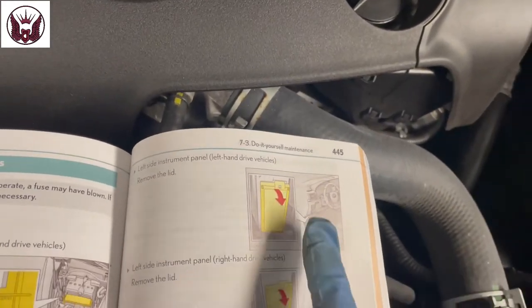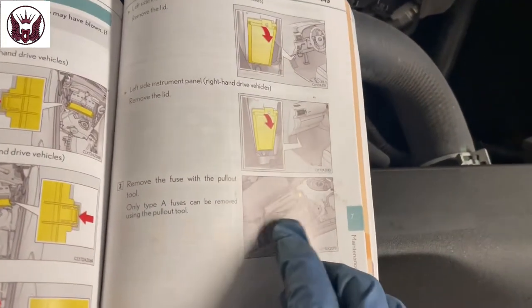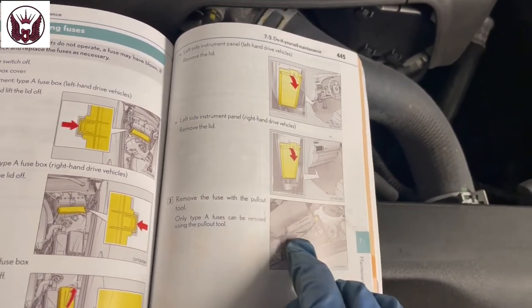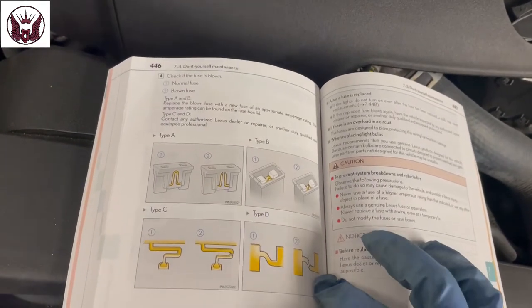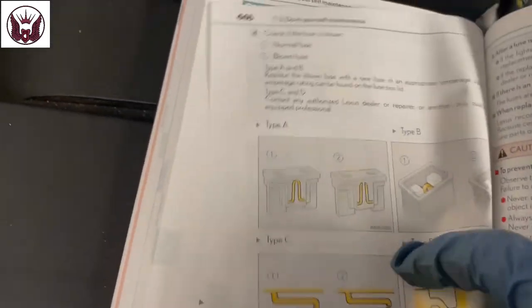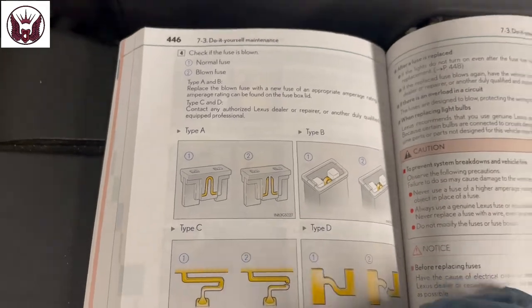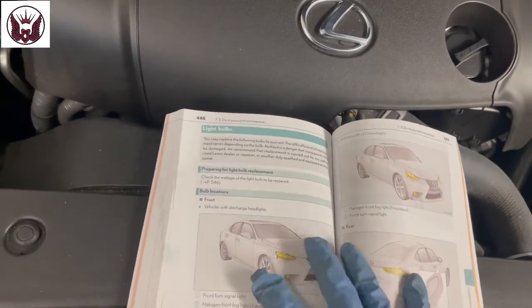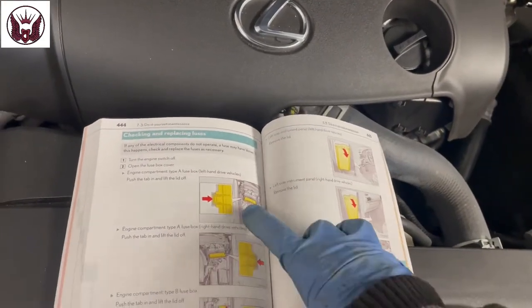The other one will be in the same place but just on the driver side. This also shows you there is a little key for removing fuses, but only type A fuses can be removed using the pull-out tool. And this chart here shows you what a broken fuse will look like — that will be good, that will be bad. You can see the little filament is broken in there in the picture. So let's have a look at those fuses. I don't think I have a fuse chart in here, so maybe the fuse list is behind the covers — we'll see that in a minute.